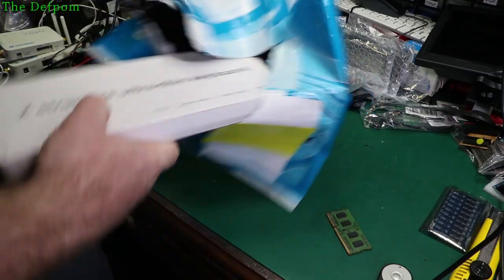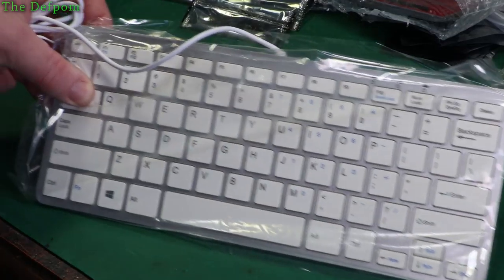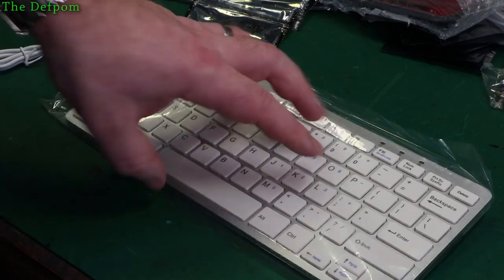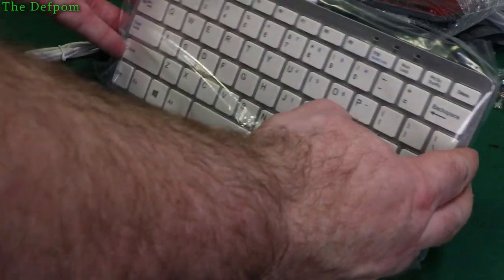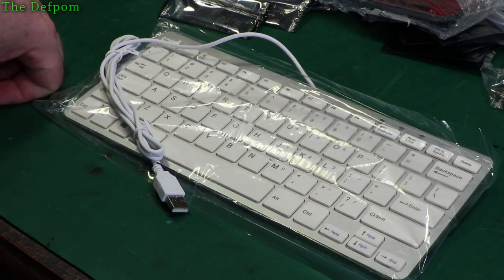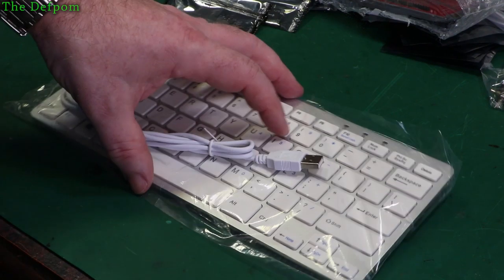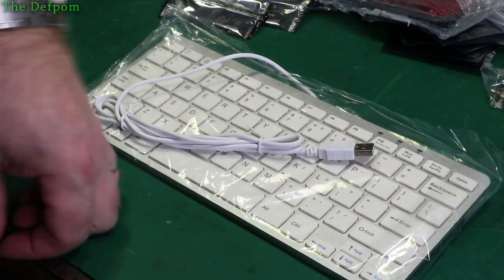Little keyboard. I bought this for this project I'm working on. I did get a waterproof keyboard, which I showed in the previous mailbag, and I had issues with it — multiple presses, you push it once and it triggers other buttons because of the big rubber membrane deformed from being rolled up. It's actually got a lot better since being laid out flat, but I don't trust it completely — it needs to be accurate with button presses. So I got one of these: it's pretty cheap, compact and small, easy to transport. It's not waterproof, but being cheap means I can chuck it in a bag. The main reason I bought it is it does not have a USB hub built in, which is a requirement because the USB host won't work with a keyboard that has a hub built into it.